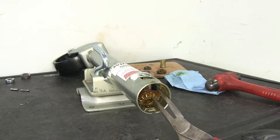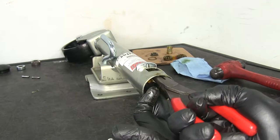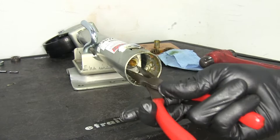For the base gear, just lift straight up and it will come out along with all its grease. Below that you'll find a little floating pin — lift upward on it and bring it out through the small hole on top of the jack. You'll also see a thin washer on the bottom. Note that these washers are not included in the kit, so make sure to hang on to them to put back in.